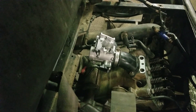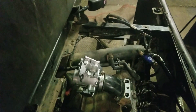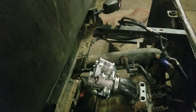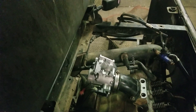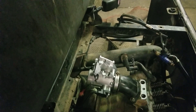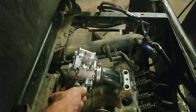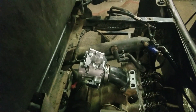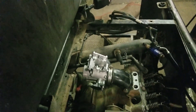There's a great video on YouTube on how to set your TPS. When I bought this thing it was set at 0.82, but if you use a multimeter it has to be set to 0.62. You loosen up the screw, turn the sensor, and dial it in so you get the right amount of airflow when the engine starts up.